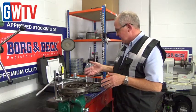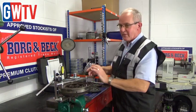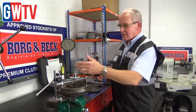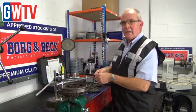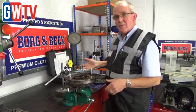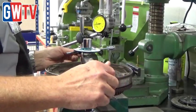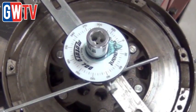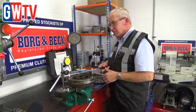This is the testing kit. There's a box it comes in, and you've got this handle that you bolt to the flywheel with the various parts in the box — you can use it to rotate and find the angular movement. The dial gauge and stand, fitted on the back of the engine, is there for checking the end float. This one is over the limit because it should be 2.9mm maximum, so the bush is badly worn. We then check the angular movement by rotating it with this lever — the free movement here is 20 degrees, but it should only be 17.